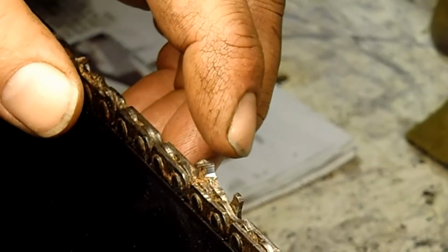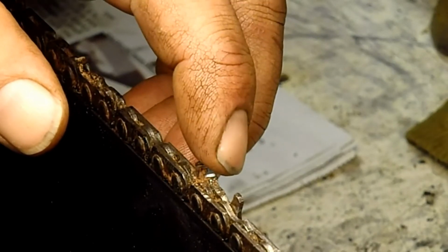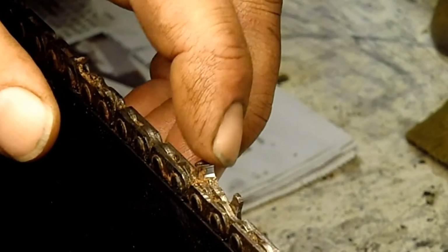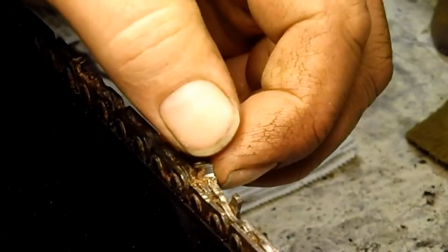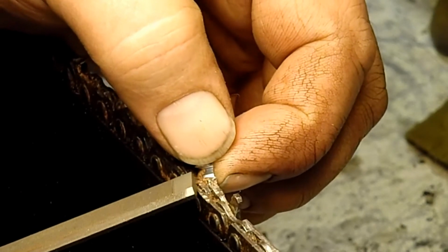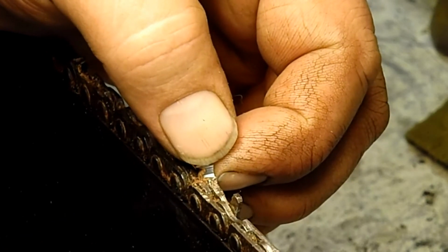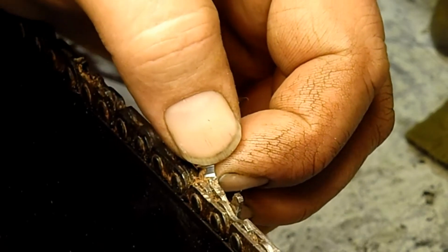Now on a round file chisel chain, primary cutting, and I think on this one too, that's the entry point, is this point right here on the tooth. And that's a critical point. The angles on these can be critical too. If you get too much overhang on here, then there's not enough support underneath this tooth, and it'll chip off or dull real fast, just like sharpening a fillet knife will dull faster than a butcher knife.